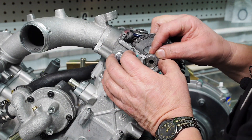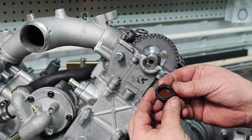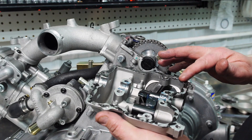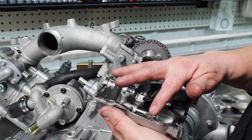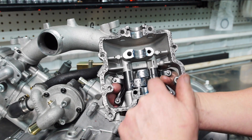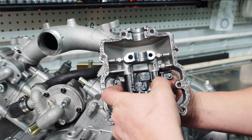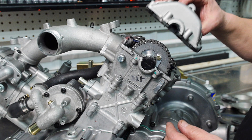Install the C-ring and then install our seal, opening down. Apply a little sealant to the cam cover. Be sure to look through these two holes to make sure that our rocker arm shafts haven't fallen, because there's a notch in them where they have to go through to align with the bolts that hold the cam cover on and lock them so they don't rotate. We look good there, so now I can install my cam cover.